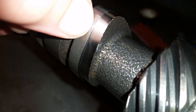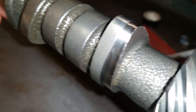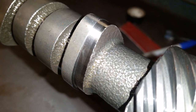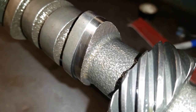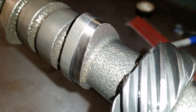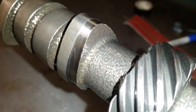And then again, on the sides right here, it's pretty fat — that's increased duration. The left side of the lobe is factory. The right side of the lobe is the 270 CompCams Magnum profile. And that is how we're able to grind a camshaft down but actually make it larger in profile.